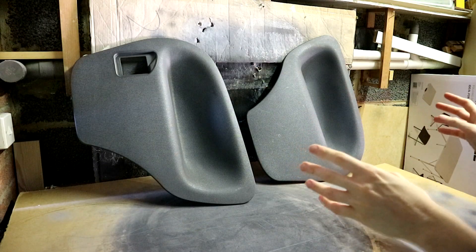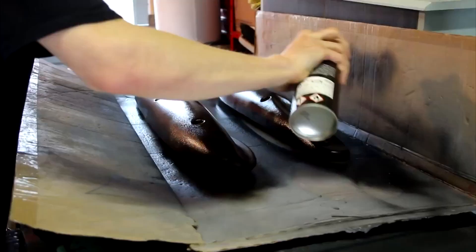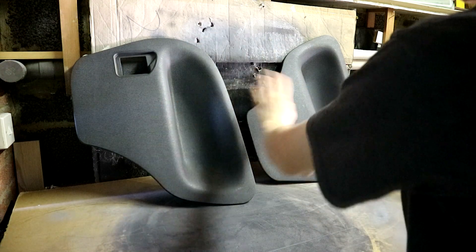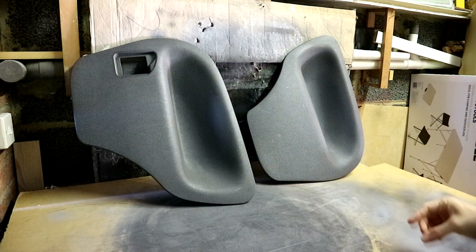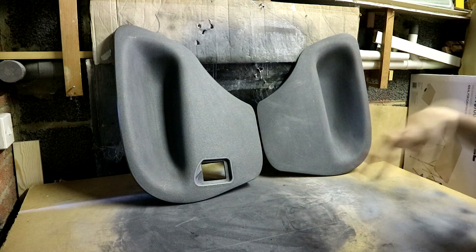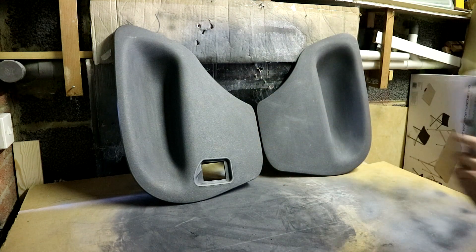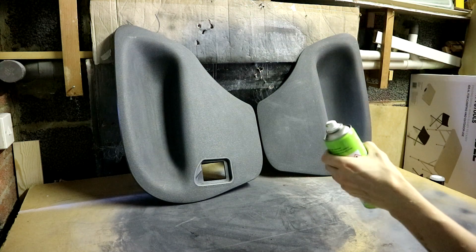We've gone more than 15 minutes without painting something on this channel, so now it's time for another episode of Joe Paints Random Stuff. On this episode we've got the rear door cards from the Super Seicento, because now that we've got the black carpet, the black rear seat delete and ever more black creeping into the interior, this horrible ugly 90-spec grey is not going to cut it anymore — it looks out of place. So first things first I'll pop the ashtray out of this one. In tune with what we've done in the front of the interior, we are going to be using that gorgeous BMW black sapphire paint — I love this colour, it's a really nice black with loads of metallic flake and it looks incredible. Before we get on to that we need plastic primer, then paint, then lacquer. So as usual on Joe Paints Random Stuff, cue the montage!